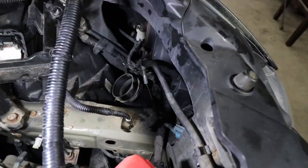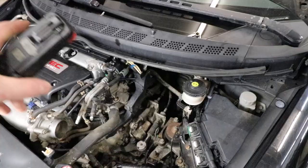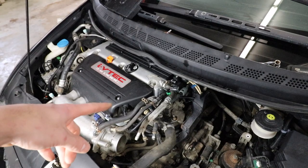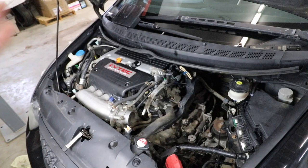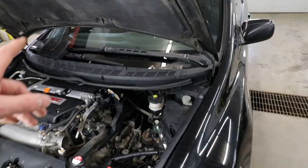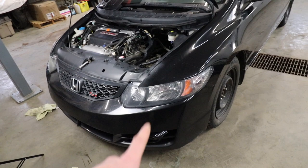I think I've got to pull the front bumper off to get that bottom intake piece out because it's a pretty big box down there. Now that we've got all that out, I'm going to pull off the little plastic VTEC cover to have access to the fuel rail when we take the injectors out, and then start pulling these panels off. There are just a couple of body clips on top. Then I want to get the wiper cowl taken off, and once that front piece is off, we'll get the front of the car jacked up to start taking the front bumper off.